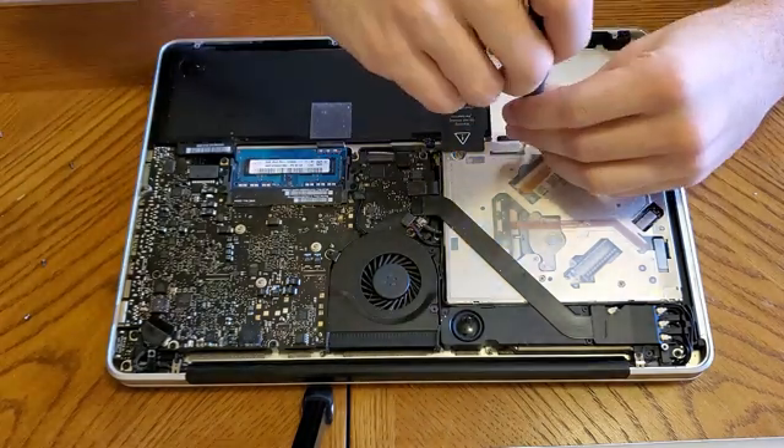It's down tight. We could test the laptop right now, but I'm actually just going to put it back together before I test it. Lay the top back on. If you've forgotten which screws go where, these top three are all the long screws. Slide the long screws in first — you'll know because the short screws won't be able to screw into anything. Get those long screws in first but don't tighten them all the way down, because then you might misalign one of the holes for the small screws. Tighten them down about 90%, then go one by one putting the small screws in. Make sure you put them in at the right angle so you're not cross-threading. If it's too hard to screw in, it's probably cross-threading.